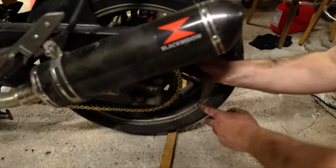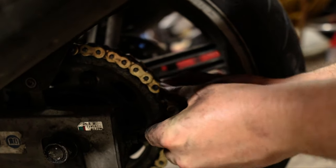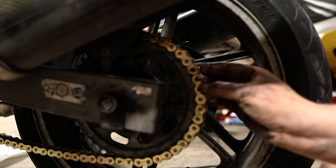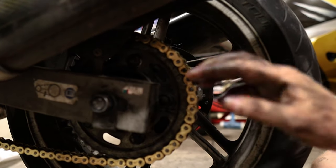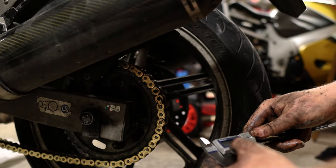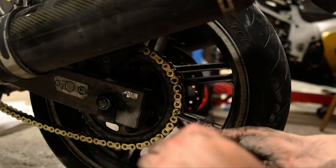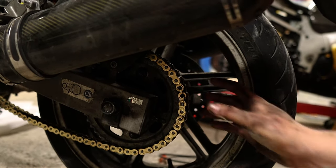Have your links positioned like this in your rear sprocket. Now the fun bit — trying to get them to home. Once you're at this point you need to put on the next O-rings or X-rings, and then push on your face plate with the writing facing out. Before we do that, how I do this is I measure the thickness of one of these plates — 22.3, 22.16, 22.6. So if we aim for about 22.4 when we press this on, we're good.